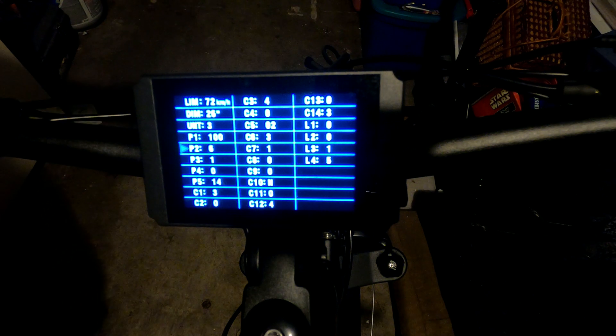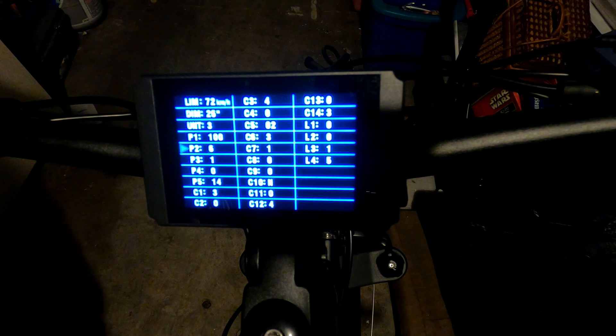P2 is the wheel speed sensor setting, based on cycles per rotation. Bolton's guide said to set it to 5, but that didn't work for me — when coasting without pedaling, it would shoot up to top speed like 49.6 mph. I tried all values from zero to six, and finally six worked. I think it has to do with the 12-magnet pedal assist sensor on the bottom bracket. If your bike shoots to top speed when coasting, set P2 to 6.